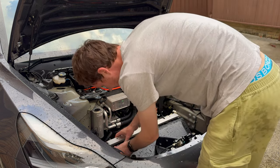Once it's in, focus on getting the front trunk in. Some of those clips are metal so be careful around the back that they don't scratch the fenders. Take it slow, take your time and you'll be fine. Once it's sitting in the right spot, manually clip those in because they don't clip in on themselves just by screwing the front trunk in - you have to assist them. I'm pushing those clips in on both sides. Then align the holes that the bolts go into in the right position and screw the bolts back in one at a time.